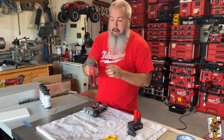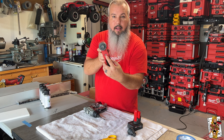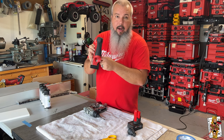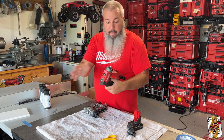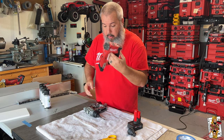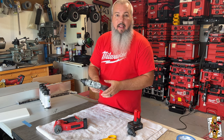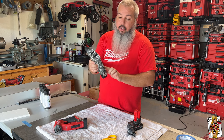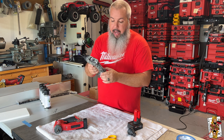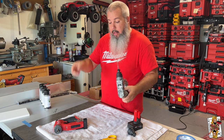The first thing I did is took everything off the drill — undid all the nuts and bolts. There's a clip in here, pull off things like these little button panels, pull off the little light, get the drill to two bare halves. I then wiped it down and removed the sticker. I didn't mask this sticker off, removed everything that I could, wiped it down with rubbing alcohol, and then stopped touching it with my dirty paws. A rumor is that this rubber grip won't last, but Rob's Customs on Instagram has been doing these for a while and they slowly wear. He said don't worry about masking off any of the rubber because you can take a super aggressive sticky tape or a scrub pad and scrub the rubber parts, exposing just the rubber. If you don't want the rubber covered, don't mask it because it's really hard to. So let's move on to what you need.